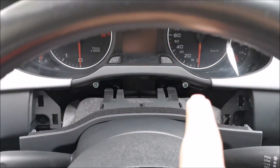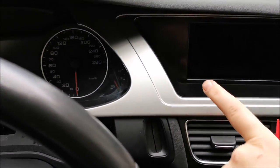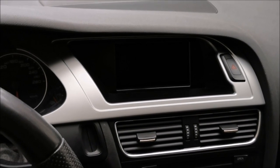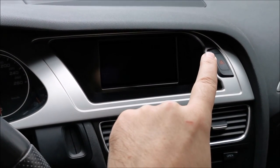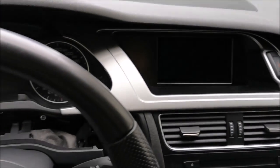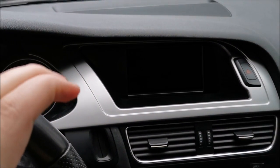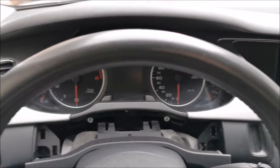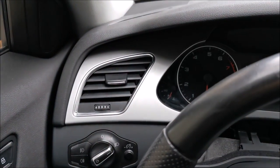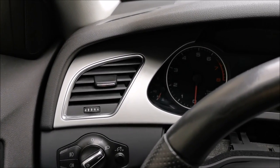So you now have the screws to the cluster accessible, but we still need to get this piece out and this piece out. They will actually be replaced with ones from the A5, but we will be keeping that button. Do not put the A5 button in your car — it will give an error. The ones from the A5 are already wrapped in black carbon fiber, so it will look a bit different. If you want to see a video about that wrapping process, I will have it linked in the description.